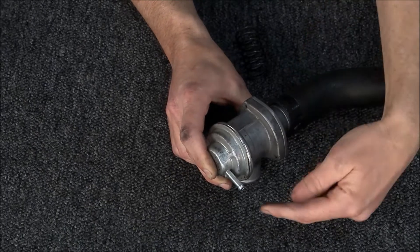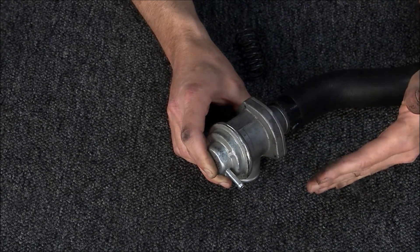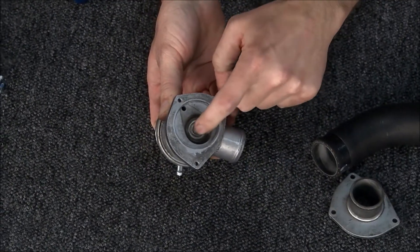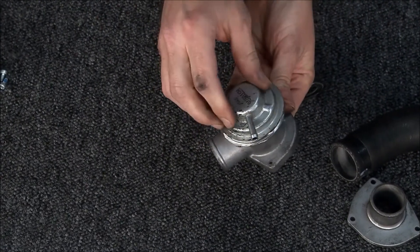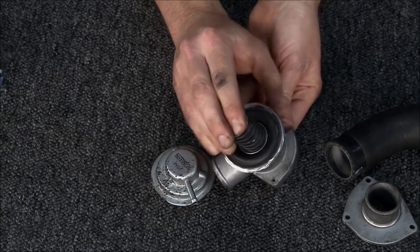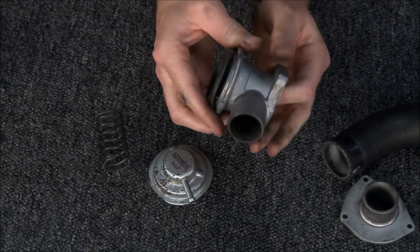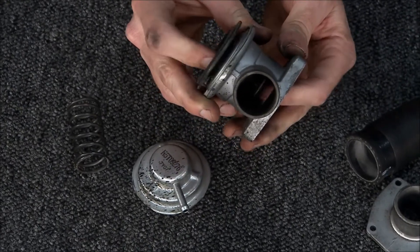Not a big deal, because over here I can put a vacuum line, and when I close the throttle, on the back side it's going to be a lot of vacuum. That's going to actuate this valve. Let me show you how it works. So pressure here — there's my valve, I've got to get past that. Now if I cut it open here, this spring is sitting inside with a lot of spring pressure, keeping that valve closed, until I open it up. You can see that valve open and close — that's how my actuation works.